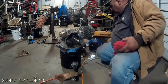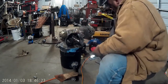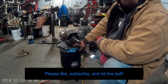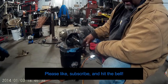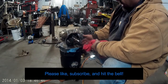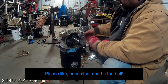Now, in times past this is where the governor arm would have come through the block — it would have been a little J-rod running a plastic gear in the side cover itself. I've already done the delete here. I've already tapped the top of the block and the side of the block where the oil cutoff sensor was, and it's already been deleted out of the inside of the block. That can be done and left inside — just cut the wire — but I went ahead and pulled it out so that we have extra volume for oil inside. When you're going to zing these at high RPMs, you want more oil.